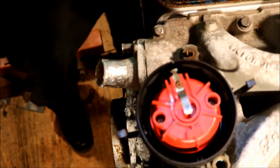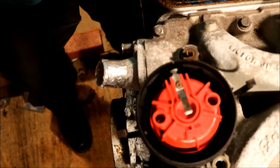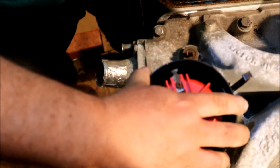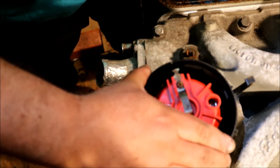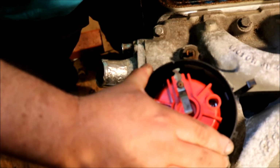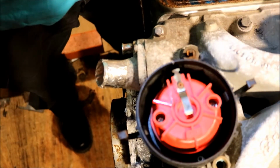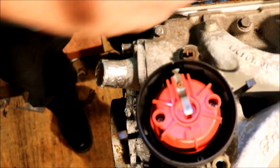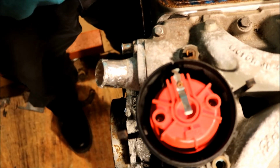A lot of people, if you just see it done one time, it's real easy for you after that, and you can go ahead and do it. And then when you're turning your adjustment, you're not moving the distributor or the drive shaft itself in the rotor. You're moving the housing. That's why that peen mark that the machinist made is kind of important for zero. But it can be a pencil line, whatever route you took to mark it, as long as you've got an indicator down there. Anyway, that'll do it for right now.